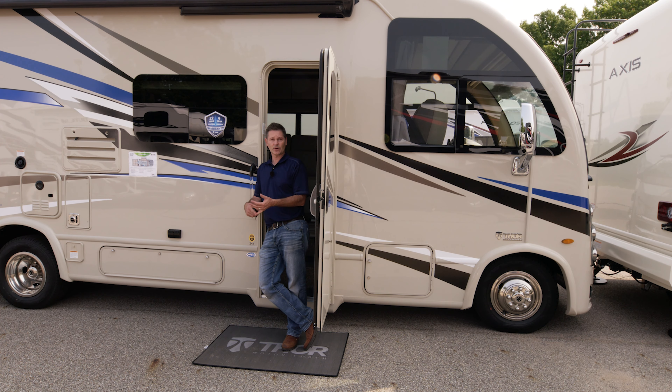You're going to use Rapid Camp Plus, which is located here on this motorhome. If you want to put your awning out, simply go to the awnings tab, hit extend, and hold it down. Your armless awning comes right out. It is recommended that when you go away for an excursion or at night, go ahead and put your awning in to prevent any damage if the wind would kick up or an unexpected storm comes through. To retract, just hold the retract button — really easy.